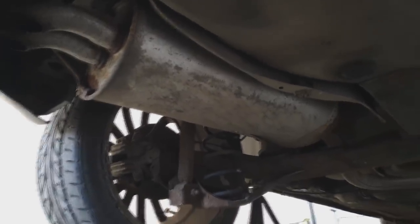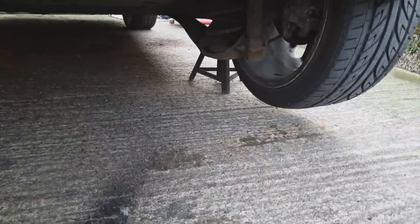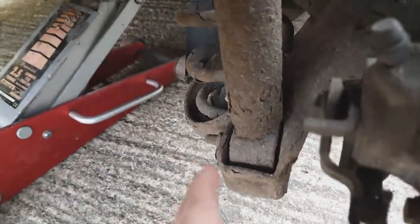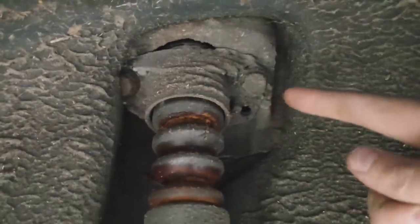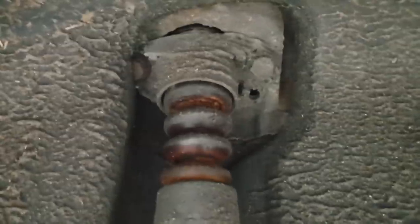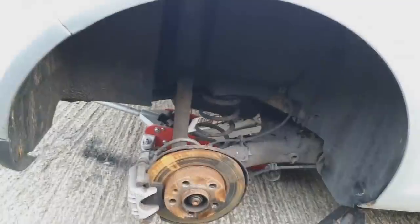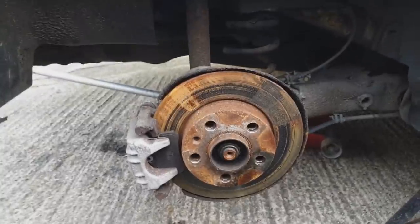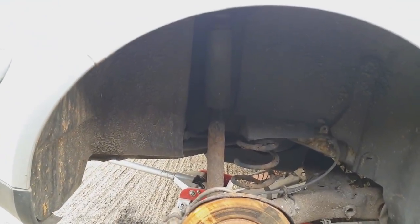Wheels off — now here's the rear assembly. There are three bolts involved: one nut on a bolt on this side, and two more bolts — one there and one on the other side. I'll spray WD-40 on all of them and impact gun them off. I've used my jack to support the beam — not lifting the car, just supporting the beam — because when I remove those bolts, the beam will drop and that's how you get the springs out. I'll start with the top two, which are 16mm. I've bent the plastic out of the way with a screwdriver to access the second one.